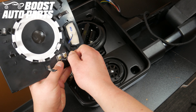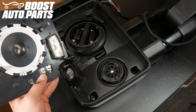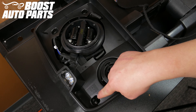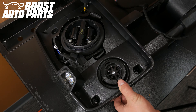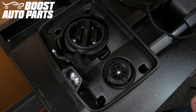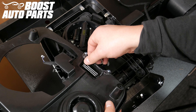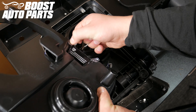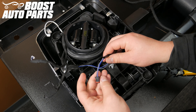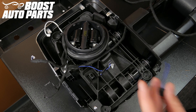Unplug the terminals for defrost as well as the connector for the signal on glass. Adjust the power adjust motor to the upper inner corner of the mirror. Unscrew and remove the four Phillips head screws holding the shroud to the head of the mirror. Pull up and out on the shroud to remove it, then unplug the connector for the cargo or reverse light and place the shroud to the side. Unplug the connector for the front marker light and cut off the connector leaving at least two inches of wire. Do not discard this — place it to the side.